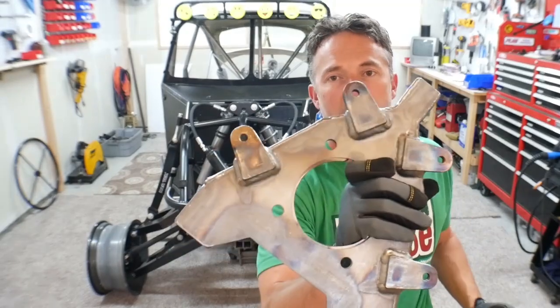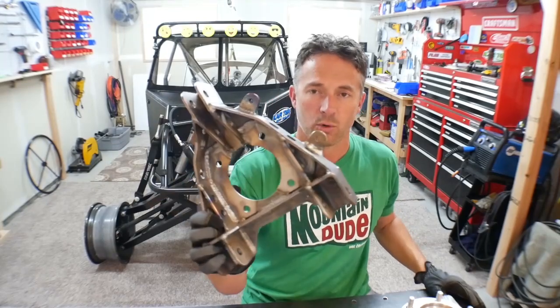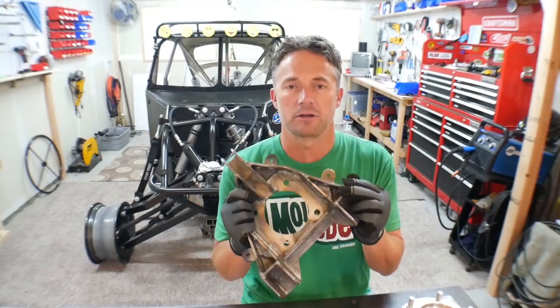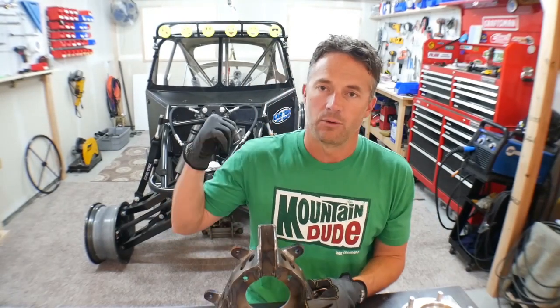The tabs for the calipers are three-eighths of an inch thick — that's pretty thick — but I usually try to build the components of my braking system a little bit overkill so that I don't have to worry about these tabs bending or breaking off. These spindles are quite a bit more substantial than the ones on Muller. I was a little worried that I was making them a little bit overkill, but everything that I'm doing on Ratchet is a lot stronger and beefier than Muller, so it makes sense. The downside is every time you do that you end up adding more and more weight to the vehicle.